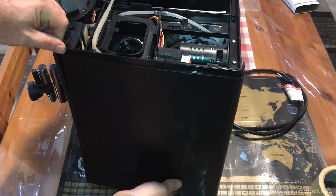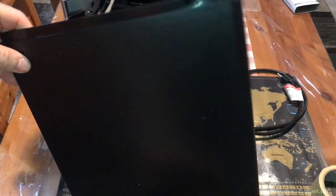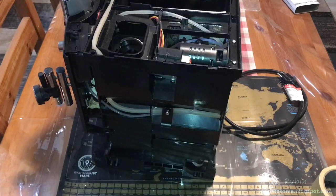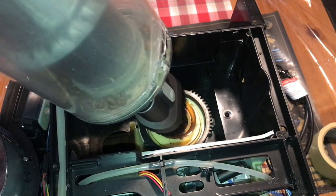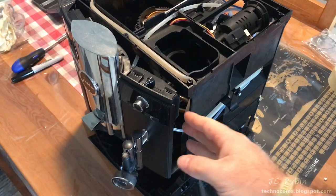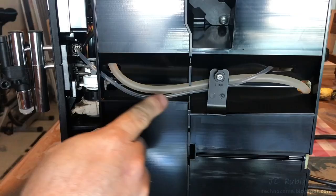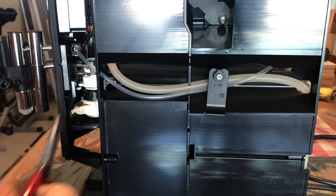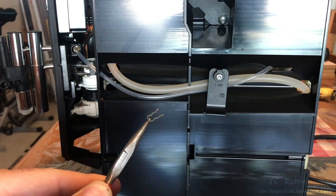Very gently bring the front of the cabinet a little bit forward — we can see two tabs up here — bring it forward from the bottom and lift up, which unseats the side panel. We can see those two tabs up closer, how they seat in. This gives me an opportunity to vacuum up the rest of the beans stuck in the grinder. The front portion is designed to swing open; we need only disconnect a few items. The thin hose leads up to the front, secured with a clip — I'll remove it with needle nose pliers, pulling down to release it. Label this as number sixteen.